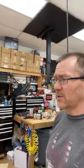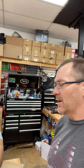You can't sum enough channels. Even with an LC8i, which for some reason everyone forgets, it's really not enough channels. So forget about the DSP. If he doesn't care about DSP, you can install just a regular 5-channel amplifier, but with the Amp Pro. You've got to get the right signal. It's a little bit more than an LC7i, but it's the tool you need to do the job. Anything else, you're just going to be hating life for sure.